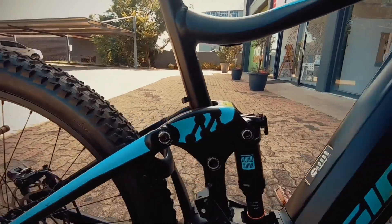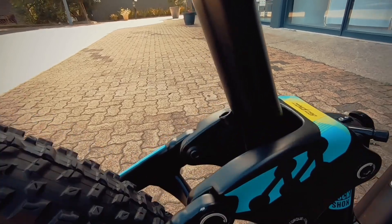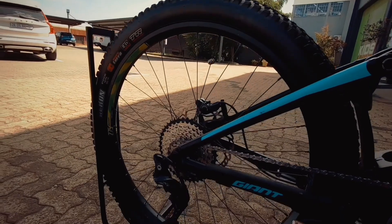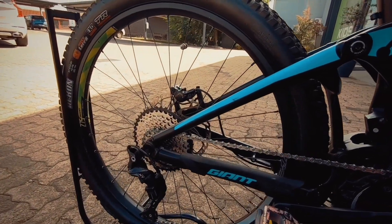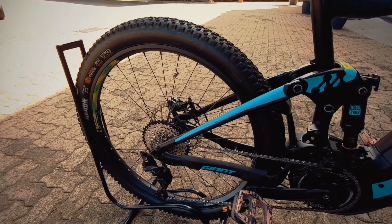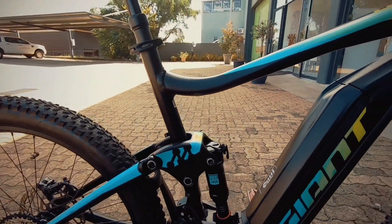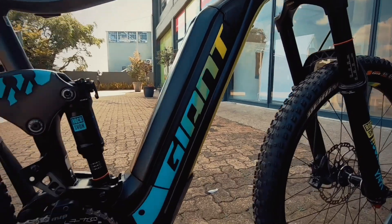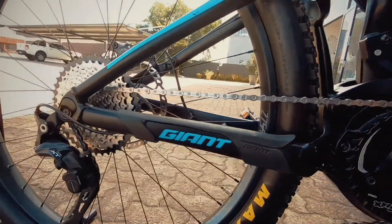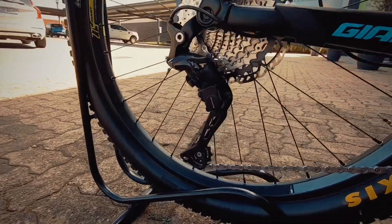Coming up to that Maestro linkage — beefed up, boosted, and done everything you can for this e-bike. On the wheels you've got Maxxis Recon tires on those Giant proprietary 27-and-a-half-inch wheels, giving you slightly more volume in those tires, making for a super comfortable and super sticky ride in the turns — perfect for enduro shredding. It's 36 up front on the chainring and 11-42 at the back, really nice for the climbs.